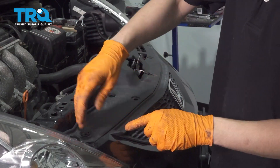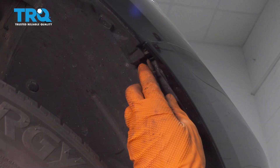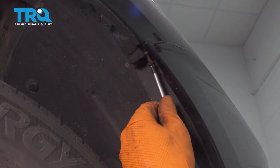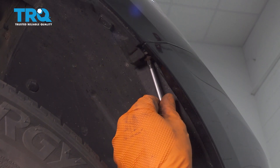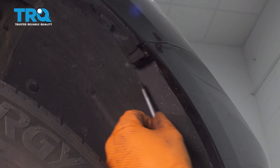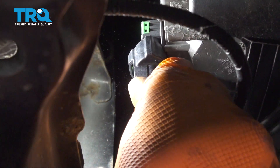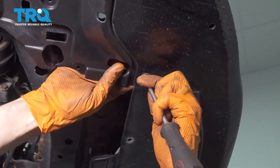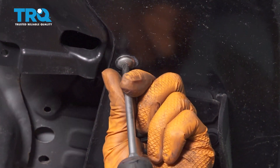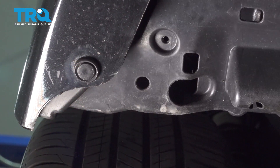Put the clips back in here. Reattach the screws on the side and make sure they're nice and snug — do the same to both sides. Don't forget to plug in the fog lights on both sides. Put back the remaining screw, then replace whatever push clips you had and lock them in.